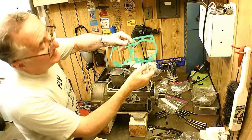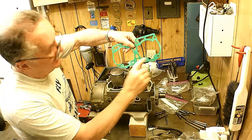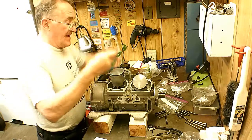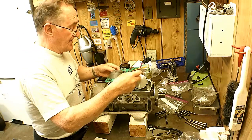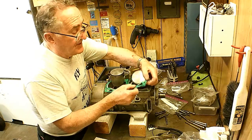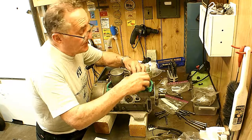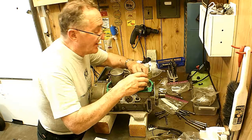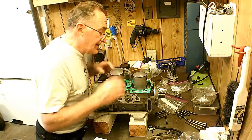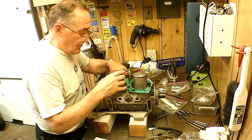You'll notice the gasket right here has a notch out for the transfer port, and the 583 has a pretty wide notch there for that. So you've got to make sure you have the gasket for the right engine — don't be using one for a 582 on here. That might not fit so good, although you could probably cut it and make it fit. You could make one for a 582 work on here — just have to notch it out a little bit. Not too hard for anybody that's proficient with scissors.